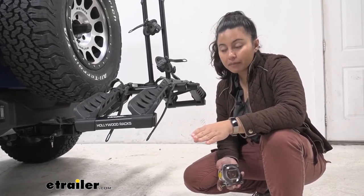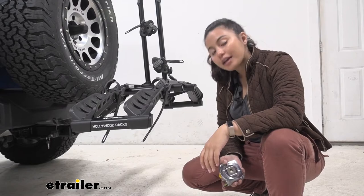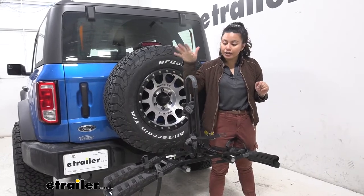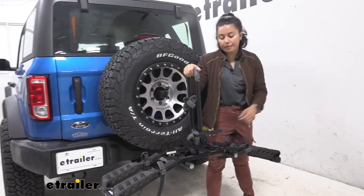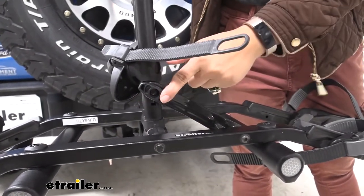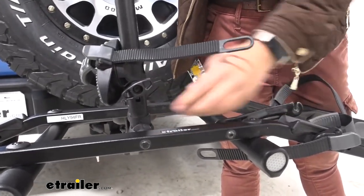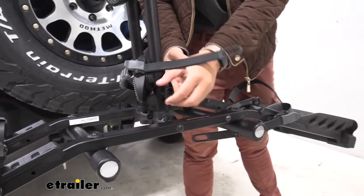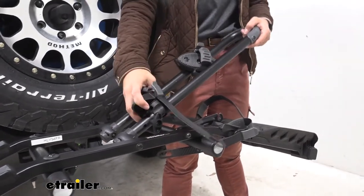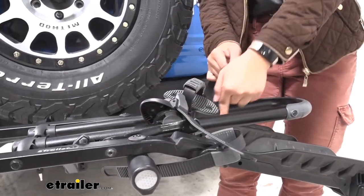What some people don't think about though is how high you're going to lift your bikes up onto your bike rack. With this only having a 35-pound weight capacity, you probably won't be hurting for how high this goes. If you're driving around town and you don't have your bikes on just yet, you may want to bring this mast down — this is also what you need to do to fold it up for easier storage. You're going to rotate this knob just a little bit so you can lift the stand out of the way, then tighten that knob back down. Once released, you'll be able to swing the entire mast down, and this will be secured with either your frame mount strap or your wheel straps.